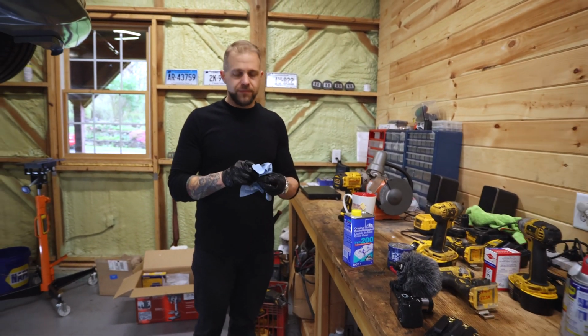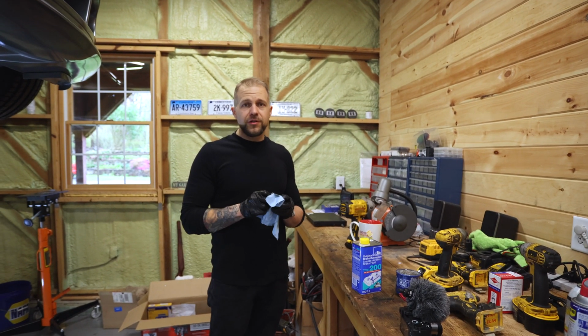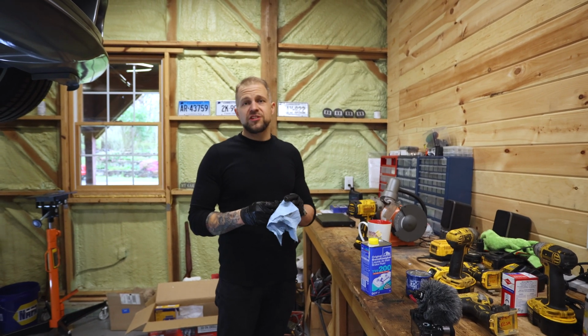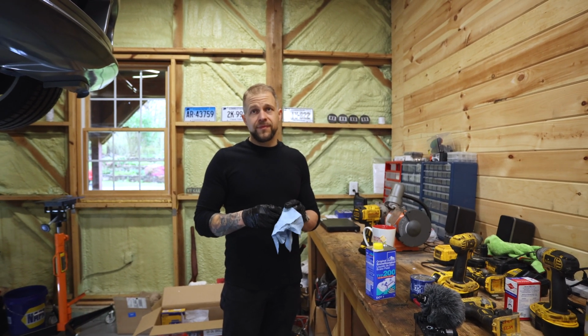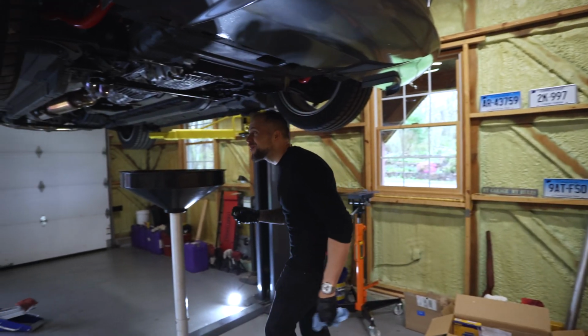Over time, moisture. Well, it breaks down. Yeah, it breaks down. You can boil racing brake fluid if it's old. So depending on how many track days you're doing, you probably want to change brake fluid once a season. Yep, that's what they say, once a season. And I'm just citing that from my own experience.